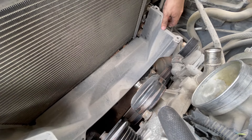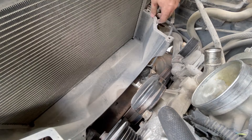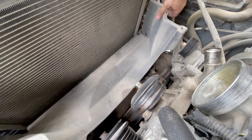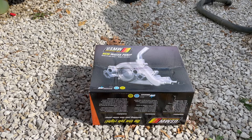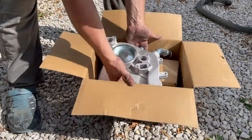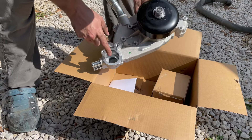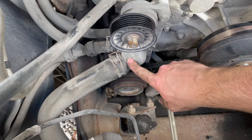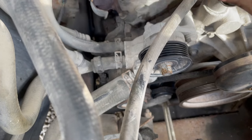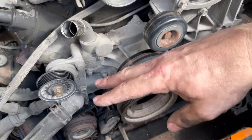The lower shroud rests in these little notches — when you have it pinned and bolted it doesn't go anywhere — let's get that out of here. Here's our new water pump, USMW Professional Series. There's the thermostat housing, the thermostat, and there's a tech bulletin. Next I'm going to be removing the thermostat housing hose and these two hoses for the heater core, then the six bolts that hold this onto the engine block — remove all those and yank this thing out.